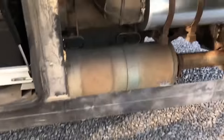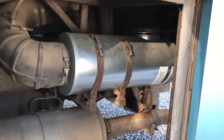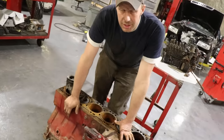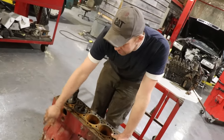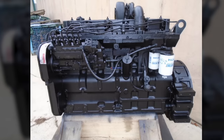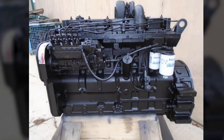Other than that, it's a very stout engine. If you're buying a motorhome that has an 8.3 in it, I would sleep well at night knowing that Cummins is right underneath the bed. These 8.3s don't have tappet covers, so that's one less thing to leak. They are a very, very good engine, and if it wasn't for the weight, we would probably be using them in more swaps.